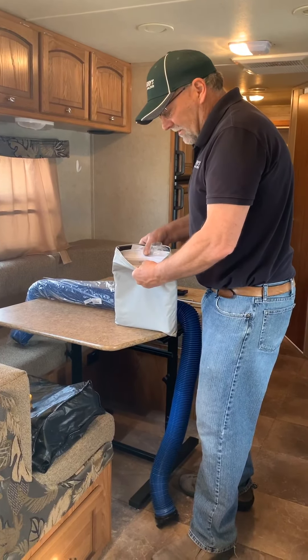All these items are 12 volt and will run off the battery on the system. You do have to plug into 110 power for the outlets to activate, for the air conditioner to work, and for the microwave to work — they will not run off the battery. But everything else in the trailer will operate off the battery system. A lot of the lights have independent switches — like these reading lights that rotate around and adjust. So they have independent switches, as do the ones on the main switch; it turns them all on, or you can use individual switches to shut them off.